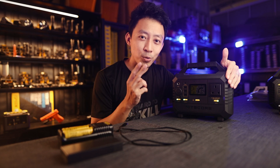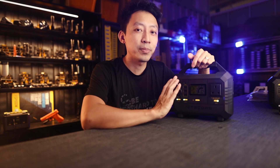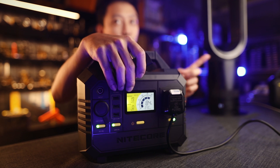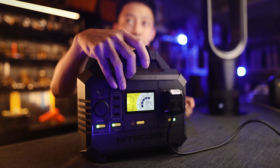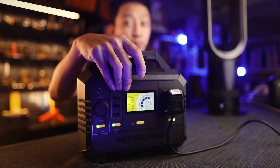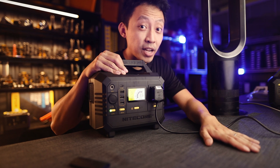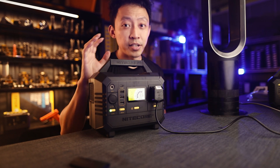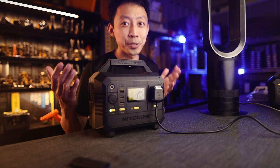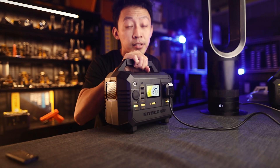You can imagine the NES 500 is about this size, while the NES 2200 will be much bigger with rollers and its own trolley. The next big question is: how long can it last? With a Dyson fan plugged in drawing 16 watts at level 1, as I increase the speed to level 10, the wattage draw increases all the way up to 75 watts at max speed. The NES 500 has 500 watt-hours, so 500 divided by 75 watts gives you 6.6 — that's around 6 hours and 36 minutes. You can also read that number directly from the display in real time, so you always know how long the unit can last with whatever you have plugged in.